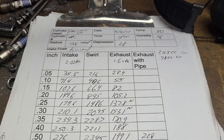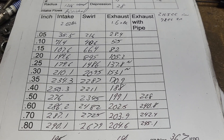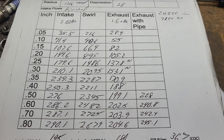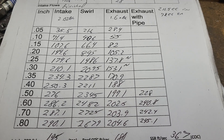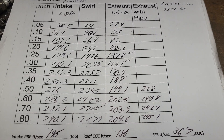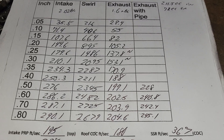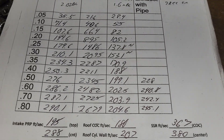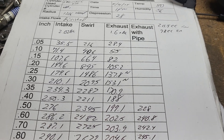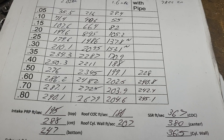Okay, this is my finished port number one. We did okay — we got 210 at 0.3 lift and we max out. I think it's a 570 lift cam he's got on the intake, so we're going to be right around 280, and I think a touch less on the exhaust. I think it's like a 540, so we're right around 200 on the exhaust. We still have a little bit of noise right in the middle. I'm not changing the port that much to work on it because it's so good after 400 — it's really smooth.